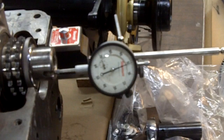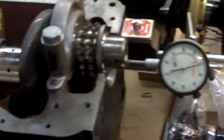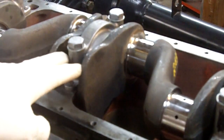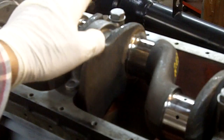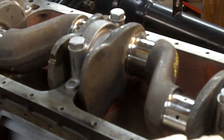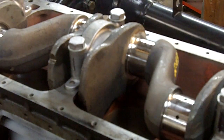And that is a crankshaft that's got the proper end clearance — end float — and the proper main bearing clearance. As you can see, it's very important to get that machine work done properly. Your crankshaft grinder is the one that dials in the amount of end float on the crankshaft itself and measures off the thrust washers. Your machinist also takes care of your line boring. And once that's done, you're ready for assembly.